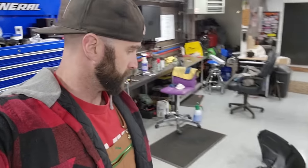Should look really good. Because it's the middle of winter and I keep the garage at like 50 degrees, I'm probably gonna do the clear coat tonight, and then I'm gonna have to let it cure overnight so it's fully dry before I put anything back together. But for now, let's get those calipers sanded up, get them ready, get them clear coated, get them starting to cure, and I'll see if I can maybe do some work on the rear, but let's just keep pressing forward. Let's go.